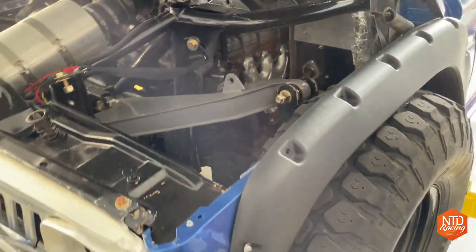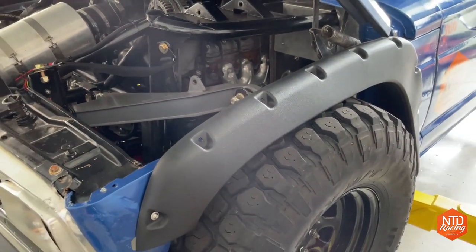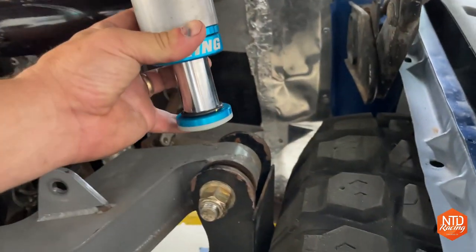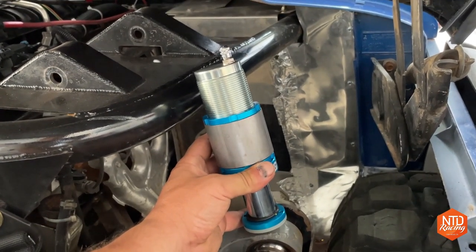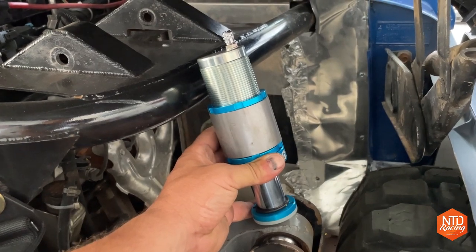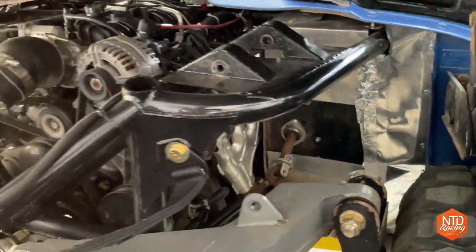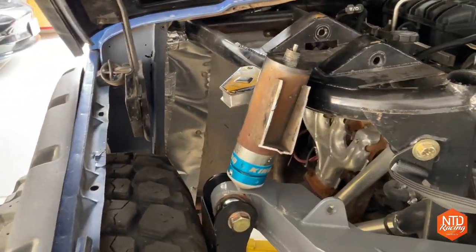Here is the truck and it is at full bump right now, right up against the fenders. One of the limitations of this build is the fenders and the hood, and for a long time I've been wanting to try to keep from going through the hood. That's why I bought these shorter bump stops. If we were to locate those, you see this sleeve right here — that's where I'd have to weld that in, so some kind of structure would have to come off this tube and to this one. I think it'd be kind of a difficult build and there always would be a big moment arm on this little part.